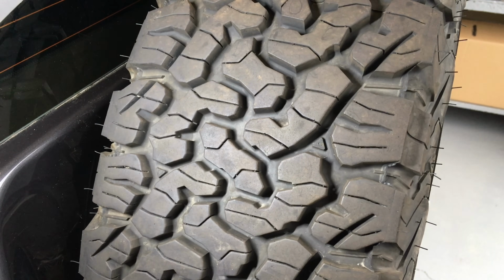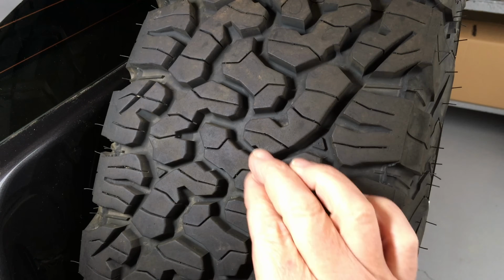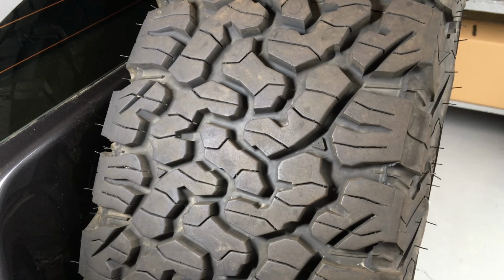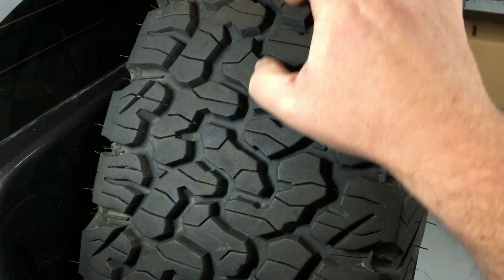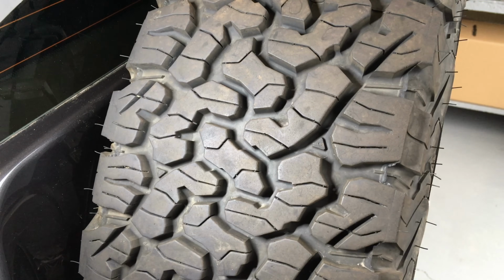Anyway, so what I'm trying to say is look at the grip, notice how the tread pattern just wraps, and when you're on those rough hills, so if it's rough, sort of shaly, kind of a few rocks in the track, the tread pattern as it goes around, it bites in, it grips. I've seen it working. I've driven the vehicles with these tyres on there, okay? I do really kind of love these tyres. They are really good for off-road, okay?